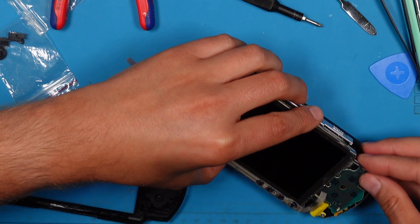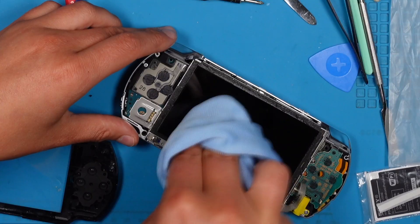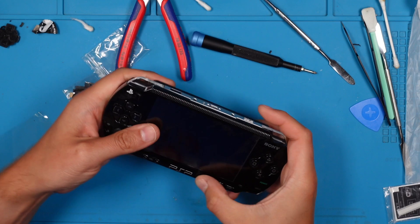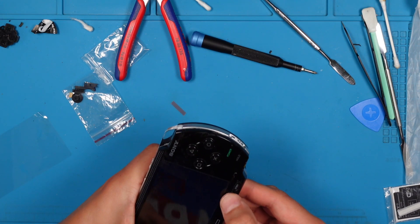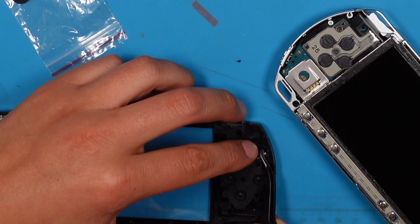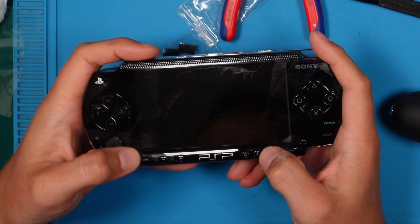Let's insert the right shoulder button. Taking the new shiny L&R buttons out of the back. The moment of truth — let's try to merge both halves. So far it fits and the buttons are working fine, except for the button bar below the screen — the tactile feedback doesn't feel right. Let's remove the double-sided tape from the button bar. The plastic parts keep falling off the case — that's driving me nuts. The second attempt is incoming, but it still feels too mushy.